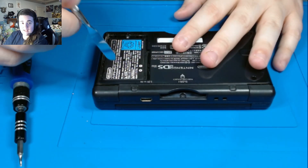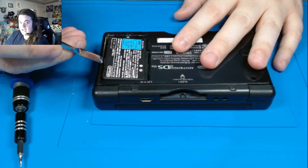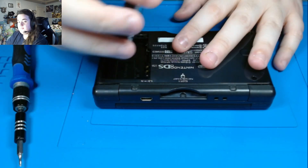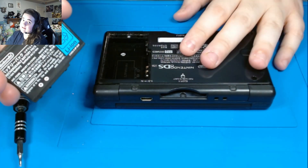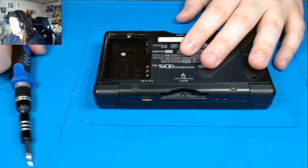When we start, we want to make sure with this battery, we want to pull out this little tab here. I find it's best to do this with a spudger, but you also can use tweezers. Just make sure you do not puncture this little battery, because it can leak chemicals, and try not to puncture with metal especially, because that could be really bad.